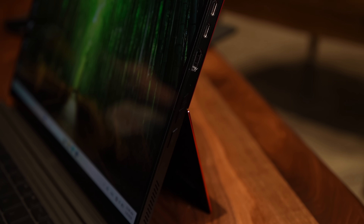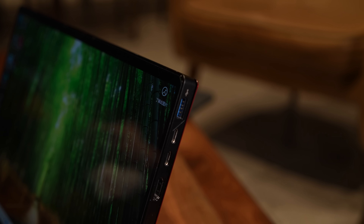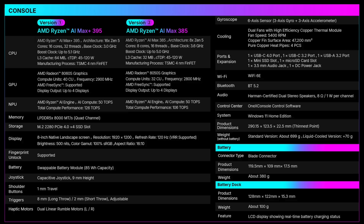Given the chipset both of these devices are powered by, we can expect some really good performance. One thing I wanted to mention is that with the Apex, they'll also be offering it with the Ryzen AI 385 — it's kind of a cut-down version of the 395. It's got 8 cores, 16 threads, and the Radeon 8050S GPU with only 32 compute units. But that iGPU is still outperforming any other iGPU in a handheld on the market right now, and the price is a bit lower than the 395 variants.